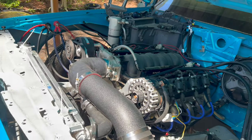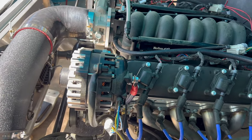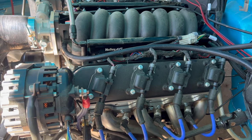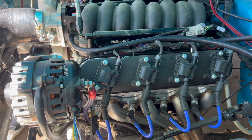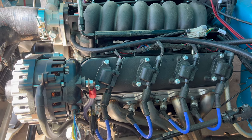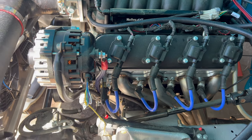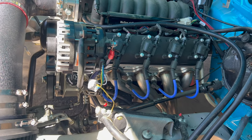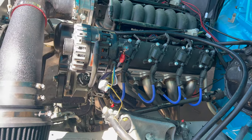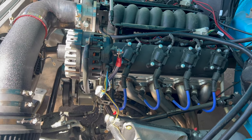Other than that, man, everything looked good. Everything seemed to be good. No more leaks, nowhere, nothing. Not smelling no fumes or no gas fumes. I know a lot of the forums I was watching said if you've been trying to start it up a long time, fuel will be washing down them cylinder walls, so it's gonna be gas mixed with the oil. So I'm gonna have to change the oil soon. I already got some more oil for it because of that little leak. So I'll probably just change the oil and get me a new battery.